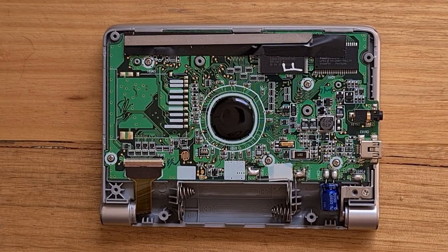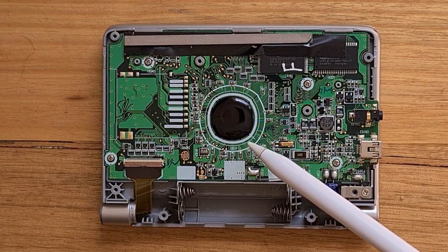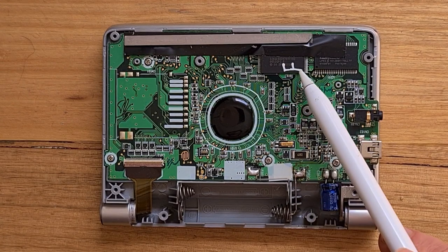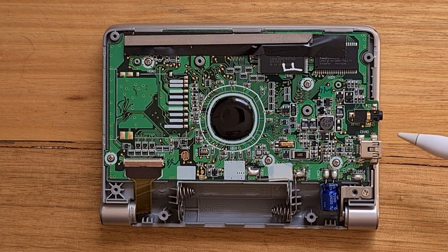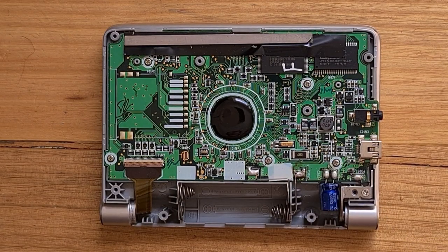This is the main PCB of the Slim that's under the keyboard. The processor under this blob of epoxy is a Hitachi Super H3, or SH3 processor, wired to the PCB using a chip-on-board design. The SH3 is an interesting 32-bit RISC architecture with fixed-length 16-bit instructions, and I'll include a link to documentation in the video description. You can also see on the board a Spansion 1.5 megabyte flash memory chip and a fairly generous 64K AMIC SRAM chip. On the right side of the board is the USB and power jack, and you can also see the flexible display ribbon that passes through the movable hinge. It's also interesting to see the quality control marks where staff in the factory have manually checked the functionality of components.